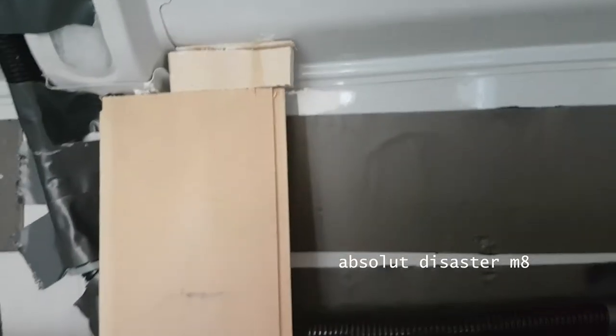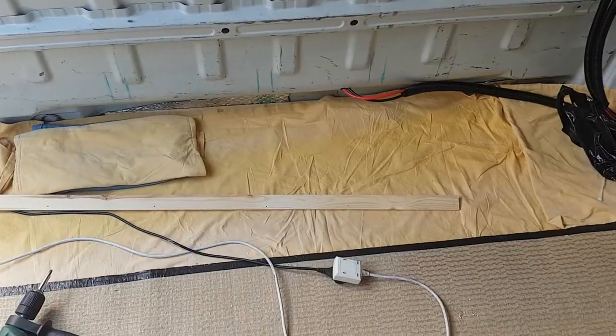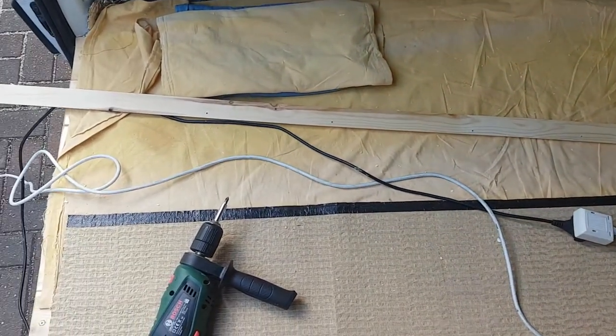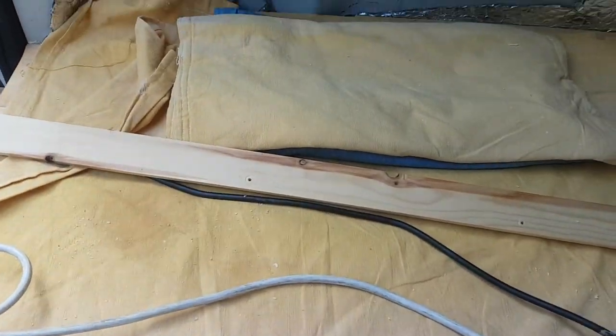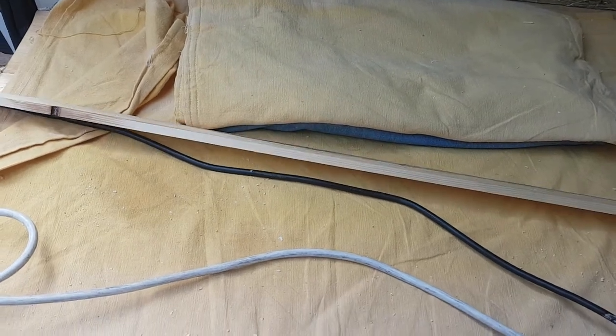The much more interesting part was doing the bulkhead — that was probably the bit that pushed my woodworking skills a little further and had a bit more of a challenge. There are only a couple of braces sticking out of the bulkhead as obvious places to put wood, but they're at a weird angle. So I put a really thin bit of batten in first and then ply on top of that. I had to use ply with batten stuck to it because the screws I had were too short to get through the batten and into the van properly, so that's what I did — took a little bit of faffing about.